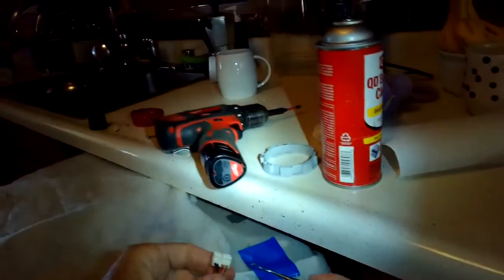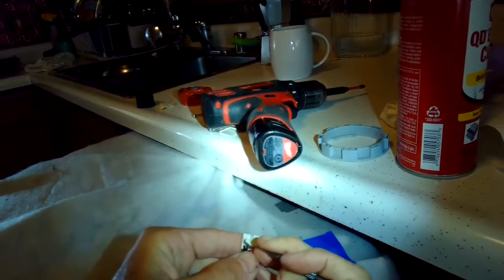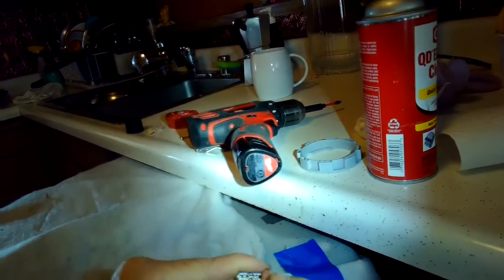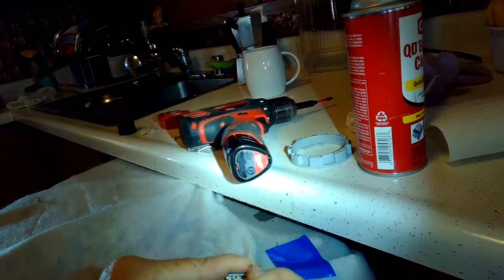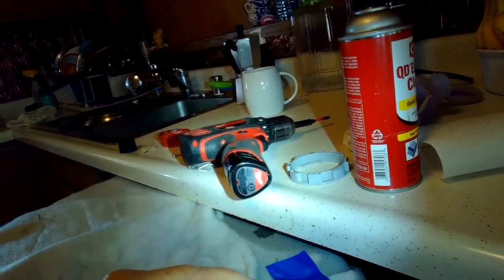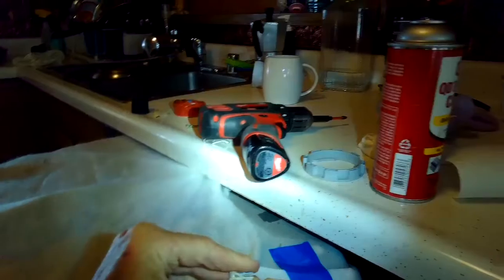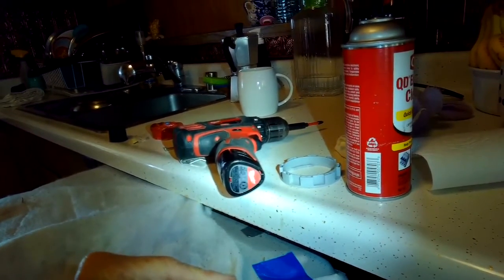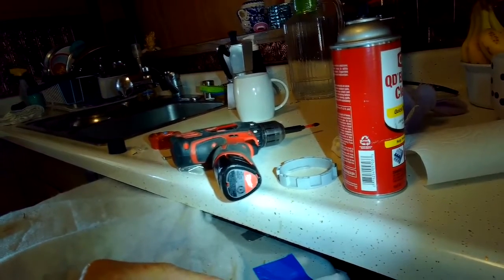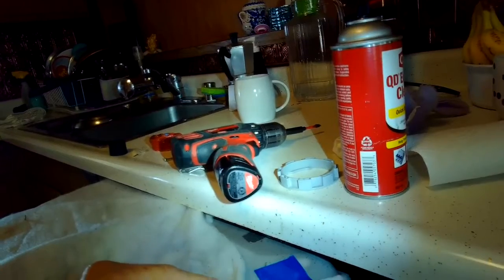So this is that idea of bending the contact just slightly inward to make better contact. But I got the same result. Sometimes that'll work though, just bending in the metal terminals so they make better contact. Just do it a tiny bit. You want to move them in by a 32nd of an inch or less. Move them too far, and you can't even get the connector back on.